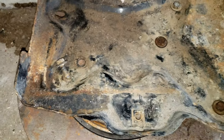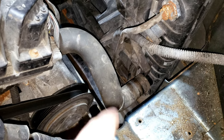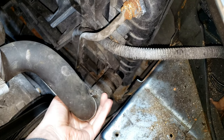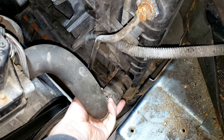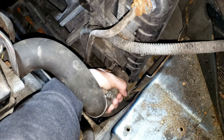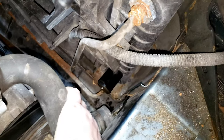On the bottom there's a plate held on by 5 eleven-millimeter bolts — pull those out and just pull that plate out. Now for the lower radiator hose, which I'm going to be replacing too — if you're not replacing yours, be careful not to tear it. These are going to be locked on here, so once you take off your hose clamp, which is a straight-head or 8 millimeter bolt head, take that off. These things are going to be locked on here — just twist it to break it loose and eventually it'll come out.